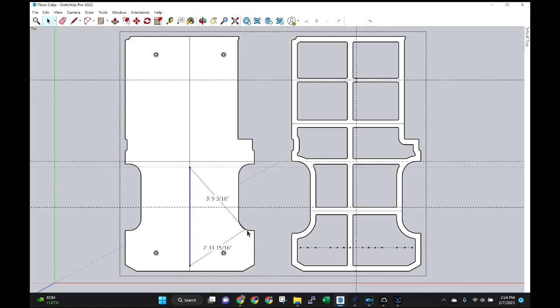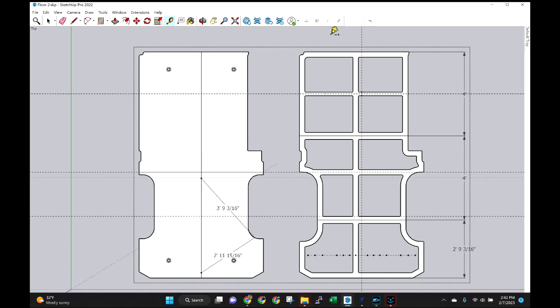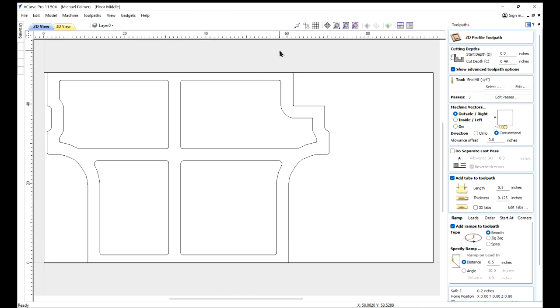I then used SketchUp to convert that shape into a frame with three-inch edges, two inches on the inside, so that becomes four, with a two-inch support bar and a three-inch support rail down the middle. I paid attention to where the ribs were on the van — the direct center is a void, so you want to avoid that. That ended up with basically two four-foot sections and about a three-foot section in the back. Then I took each section from SketchUp into VCarve CNC software, created a tool path for each, and did that three times for each section of the frame — and also for the foam pieces with the voids.